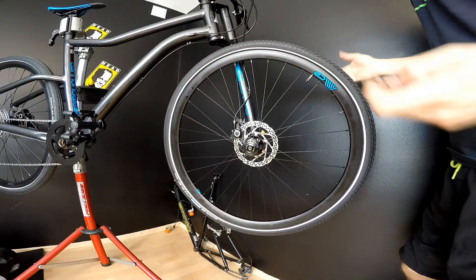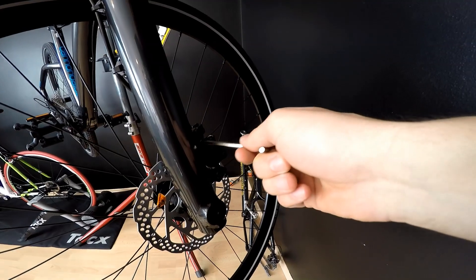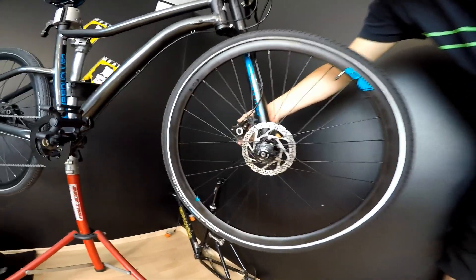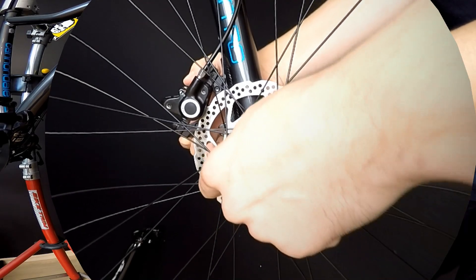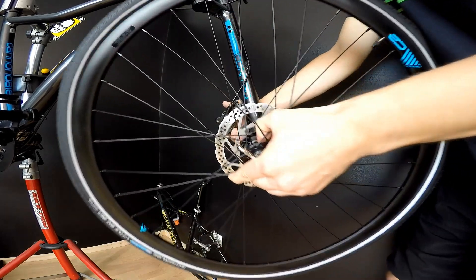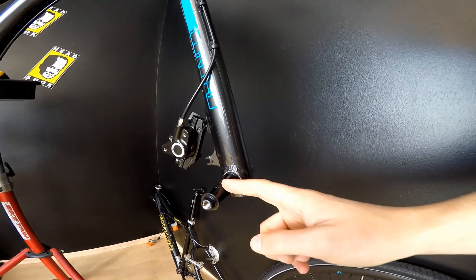We don't take this wheel off downwards but to the right side, and I'm going to show you that. In order to take this wheel off, we have to unbolt the brake caliper — just one of these bolts here, and keep the other one not too tight. Then when we take the caliper off the disc, as you can see here, we can unbolt the wheel. Here's the wheel with two bearings and the super stiff, super strong spindle of the Lefty fork.